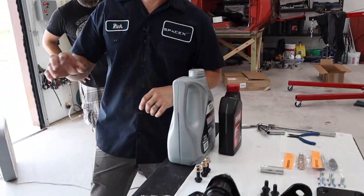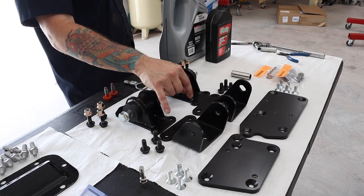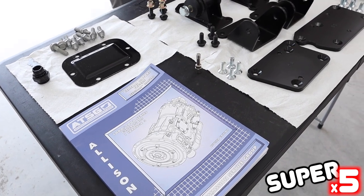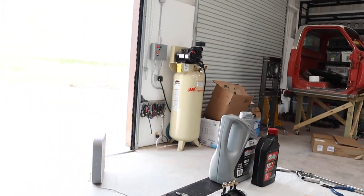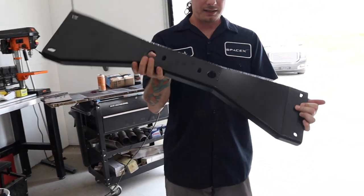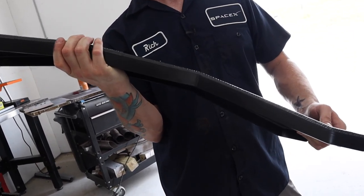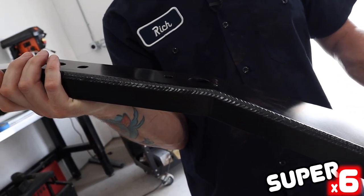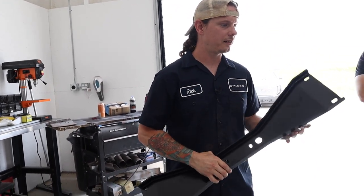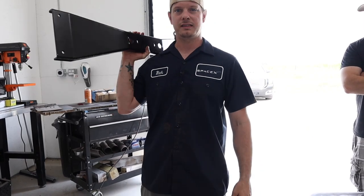In the kit, what's included are the actual mounts that go on the frame, your engine adapter plates, your upper mounts, and all the required hardware — and this is all Grade 8, super high-strength stuff. Also over here is the transmission crossmember. Just like the rest of the fab work, I mean look at these welds — it's like a stack of nickels. Super impressed by the work the guys over at Precision Fabrication Plus do. This is their SquareMax engine and transmission mount kit.